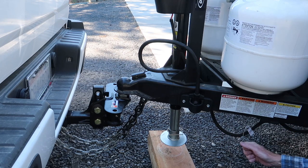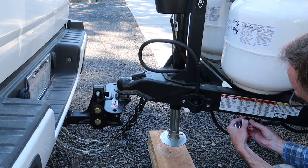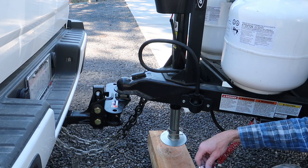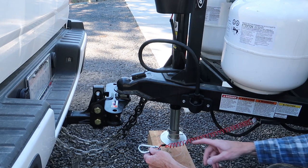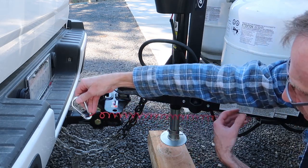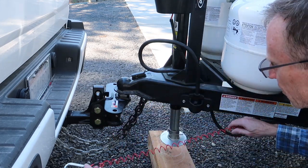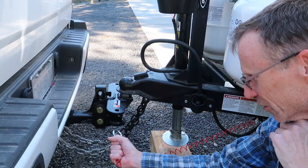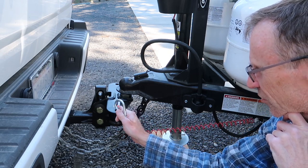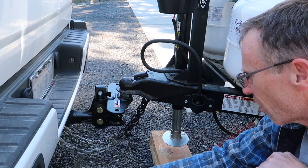So what we're going to do here is pull this out. We don't want to leave that out very long because it activates the trailer brakes and draws power from your battery. The measured length is as if the cable is completely stretched straight. With the six footer you can see it does kind of stretch out a little bit — that's why I like to go with the six foot. If you have the four foot it would really be stretched out straight. The six foot version works best with a weight distribution hitch because your typical weight distribution hitch has the ball positioned about four inches further back than a standard ball mount.